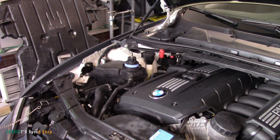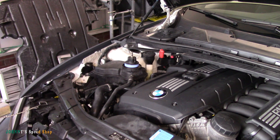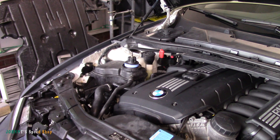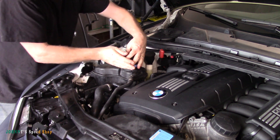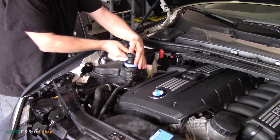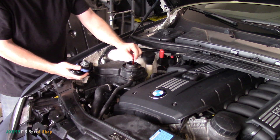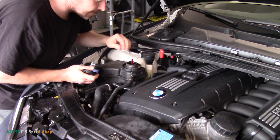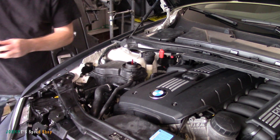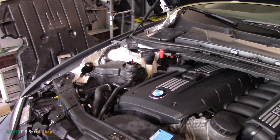Let this little bit of coolant fall back into the jug - just draining the hose back into the jug, only takes a second. You can see we're perfect now. We still need to start it up - there's probably a couple of air bubbles - but we can check with this bleeder screw right here. We're pretty much done here. It's full.